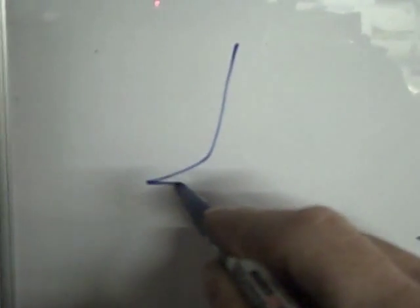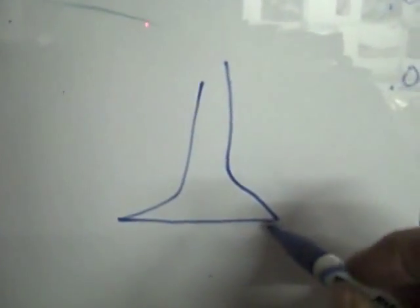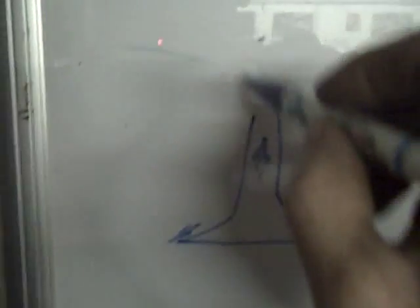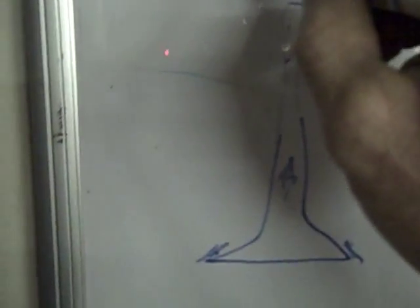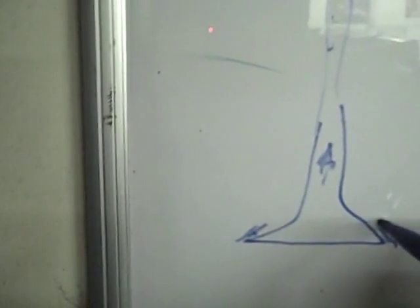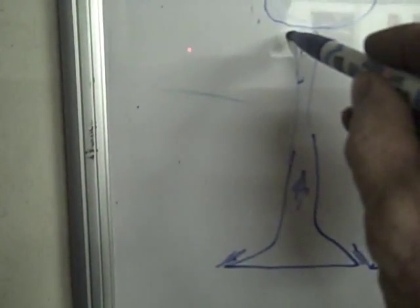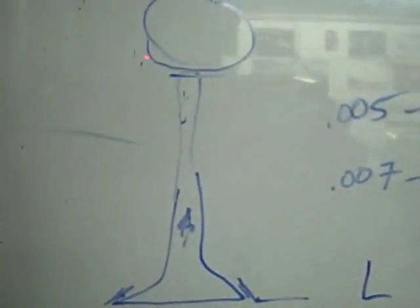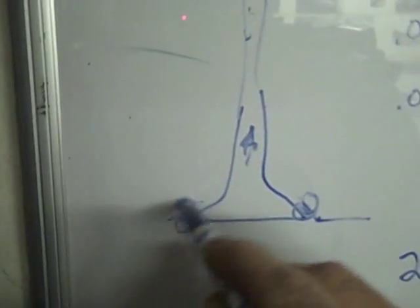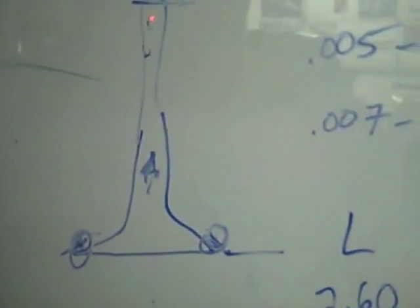Valves are like a little trumpet shape. They wear down where they seat, so the valve goes up and eventually there's an air gap between the top of the valve and the cam lobe. So you cut down to a thinner shim, and by going to a thinner shim, it closes that gap up, giving you compression so it will start easy again and give you a good tight pull. I'm going to go buy some shims and finish this video.